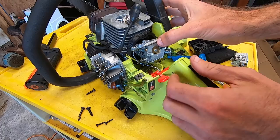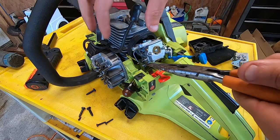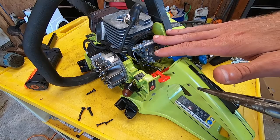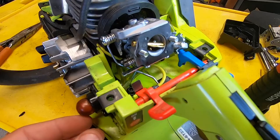We have our fuel line on the right-hand side — just connect that right up to the top. Then we have our other fuel line which I'm probably going to need needle-nose pliers for, but it just goes right onto that fitting. After that, make sure your gasket goes back on and then we'll mount up the airbox — basically the exact reverse order of how we took it apart. Get the fuel line hooked up, get the airbox back on, and get the primer bulb back on.